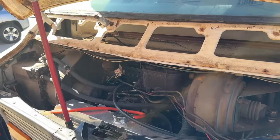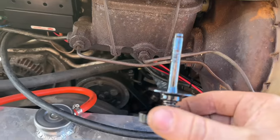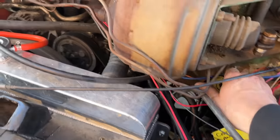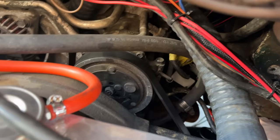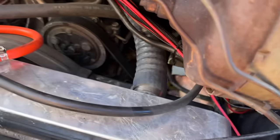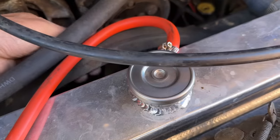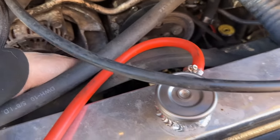So we came out here to look at it while they're cooking our food, and Ralphie said there was a leak with the power steering. This might help if I would have put the lid back on this before we left the house. Probably every time I turned it sharp, it spit fluid out everywhere. So that'll help. I think the fan's getting into it right up here. See, this blade comes in contact, I think, with this shroud. We're just gonna have to do some adjusting on that. This is leaking antifreeze right here.